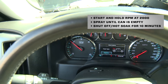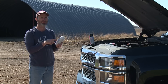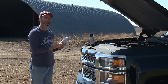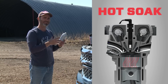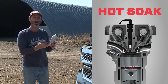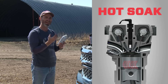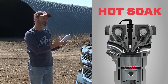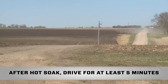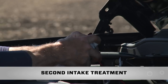When the entire can is empty, shut off the engine and let the chambers hot soak for 10 minutes. What I mean by hot soak is we just put a full can of Seafoam spray through that upper engine, so that high concentration went through there in about six minutes, and now a lot of it is still soaking in the upper intake, the intake runners, around the intake valves, in the chamber area, around compression rings and oil control rings — working to dissolve and reliquefy that heavier carbon grime. After the hot soak, I'm going to leave the straw on the throttle body, drive the truck for about five minutes to burn off that residue, come back, and we'll be ready to do our second treatment.